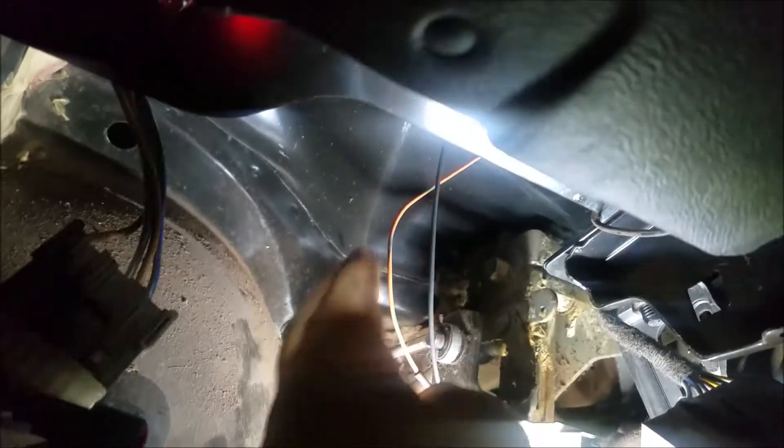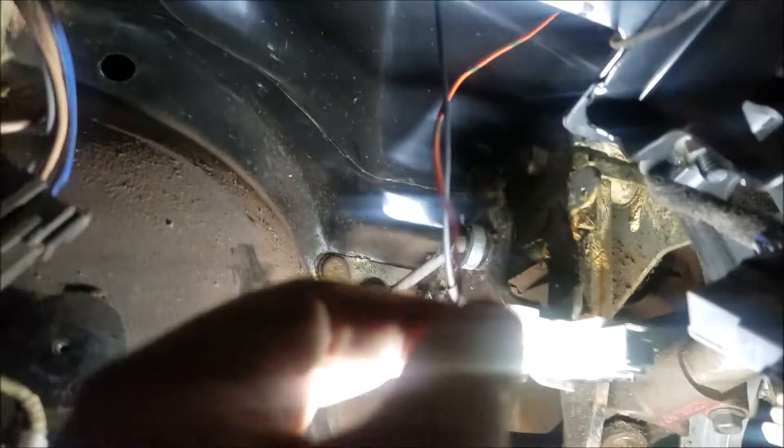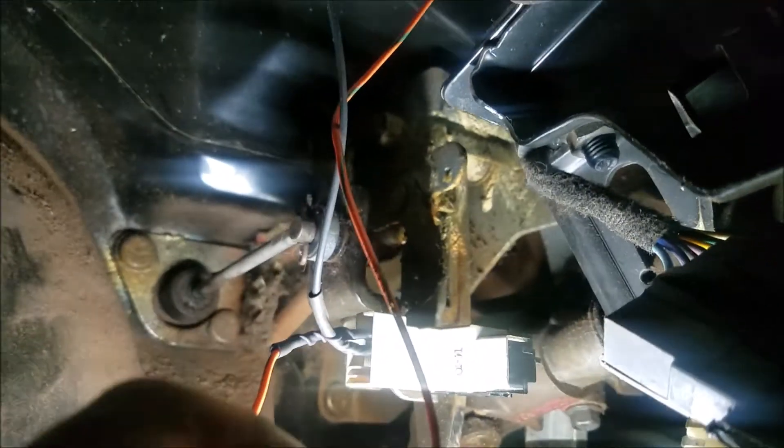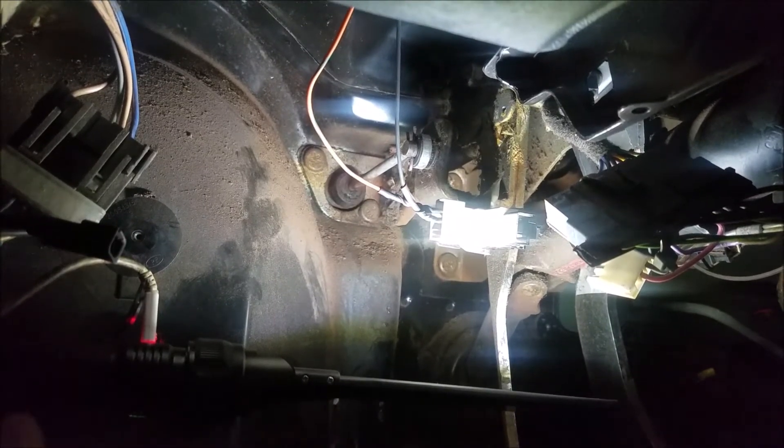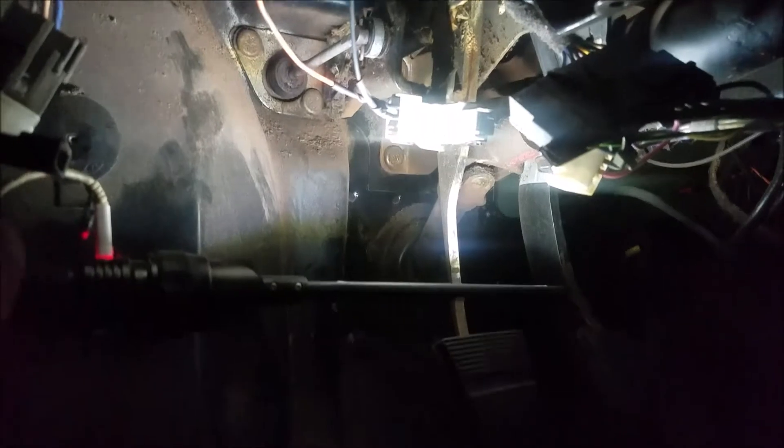Made a little jumper that goes onto the plug. We've got one wire that goes to the ground, which I've self-tapped up in there, and then we've got the one that goes to the Micro Squirt. The spare ADC will be the trigger wire for initiating launch control and no-lift shift. Then you just have to do all the software configuration, which we'll go over in the next clip.